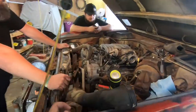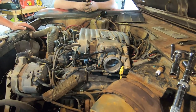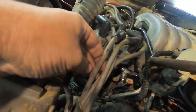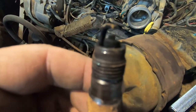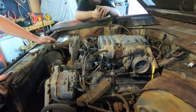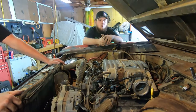We got the old Bronco running! It's got good fuel pressure now — 40 psi like it's supposed to have. It runs like a turd though, missing pretty bad. We have to look at this — it's got factory plug wires, you can see the Motorcraft numbers on them. It's got factory plugs in it and they're in horrible shape, you can see the gap on them. We'll try a tune-up next. At least it's running now, not just dead in the water.